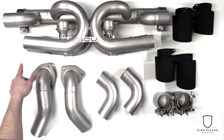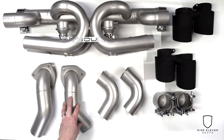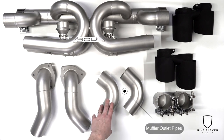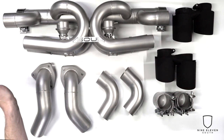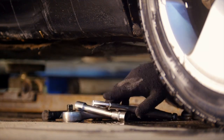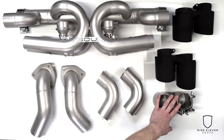You've got sections headed to the outlet and inlet. These two sections are the muffler inlets — they'll interface with the current mufflers on the car, taking exhaust out of those and into the X-pipe. Below that are the muffler outlet pipes left and right, coming out and turning left and right, connected with the supplied clamps. This couldn't be more bolt-on. I know a lot of people are hesitant to do their own exhaust — if you can't lift the car or don't have quick jacks, I get it. But honestly, this thing is pretty simple to install yourself. You've got an X-pipe, inlets and outlets, clamps, easy instructions, and your tips.